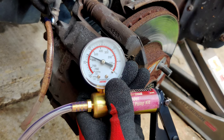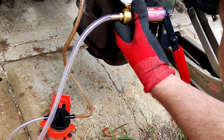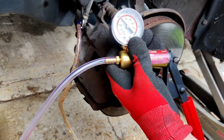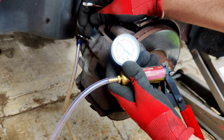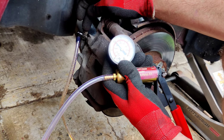You see a whole lot of air bubbles but actually a pretty good flow. If you have something like this, here are two troubleshooting techniques. Number one: you would unscrew this and then put some type of thread sealant on this screw, and then put it back in. I'll do that in a second and show you what that looks like.